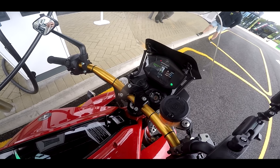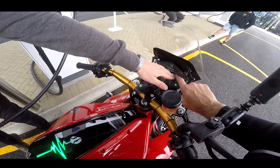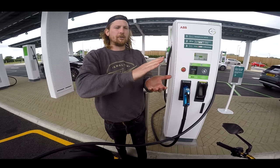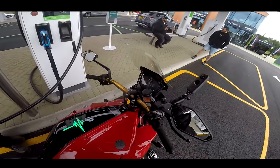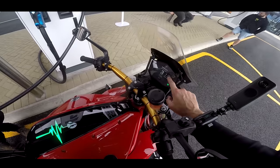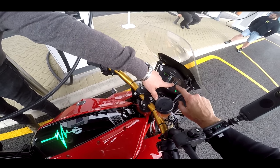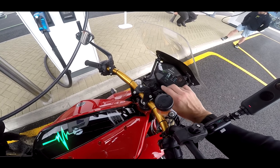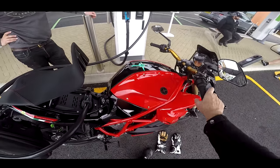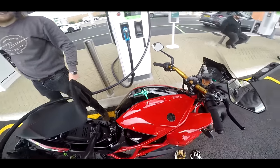So 20 minutes to charge that up from 50%. But this will increase, I see. At 14, this goes to 25. It's dependent on how hot the battery is right now, and it's kind of sloping, so it'll start charging and gradually ramp up, and then it'll ramp down. So that's charging at 14 kilowatts, and it can go up to 25 kilowatts depending how hot the battery is. We're set at 75 amps, 46 amps charging. But that's saying 18 minutes to charge it. That's not bad. You get a coffee and you're off again, aren't you? Pretty good. So that goes up as it charges? Nice.